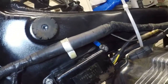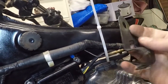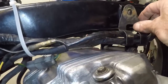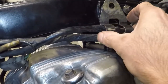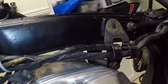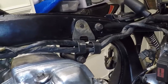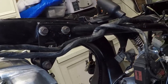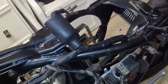I'm confident the wiring loom is on the correct side, because it's got an earthing point which goes onto that bolt, and there's a connection here which joins these wires up. The connectors go off down to the end, so the major components are in the right location. What I don't know is where this support wire goes - possibly down here somewhere. I'll leave that for now and continue piecing together connections towards the back of the bike.